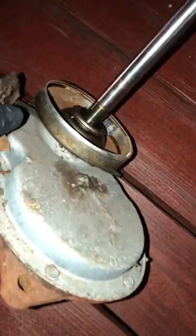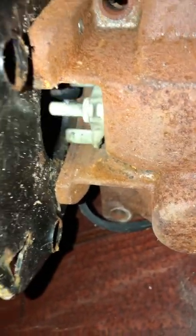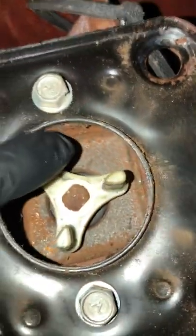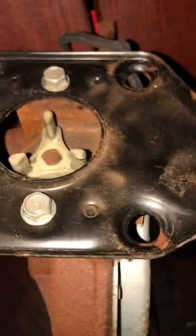This is a transmission from a Whirlpool direct drive washer — that's what it looks like. If you look under your washer, that's your coupling, or in this case part of the coupling. If this part separates or breaks in half, your washer will make a grinding or rattling, weird sound.